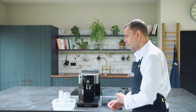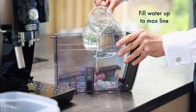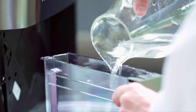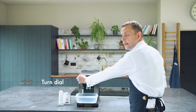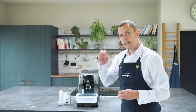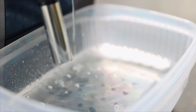Now we've emptied our water tank and our container. We're going to do the same process again, but this time I'm going to use some clean fresh water — no descaler solution — and we're going to fill up to the max level. Place that straight into the machine, don't forget to place the container back underneath again. I'm going to go to the dial and turn it the same as before and the process is going to happen. It's going to be pulse actions, so don't worry if it takes quite a bit of time between pulses. After I've done this process I'm going to repeat it one more time, and that means our machine will be completely descaled.